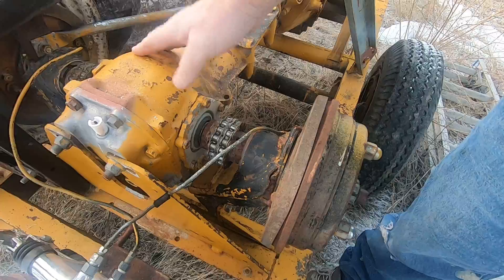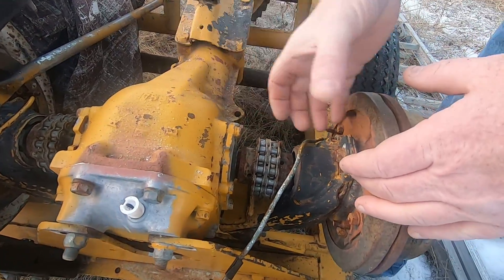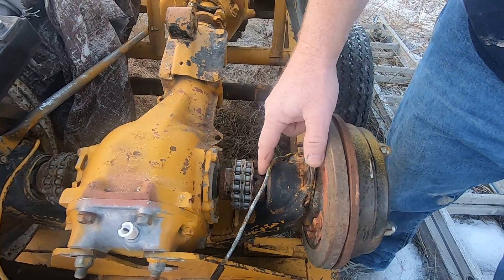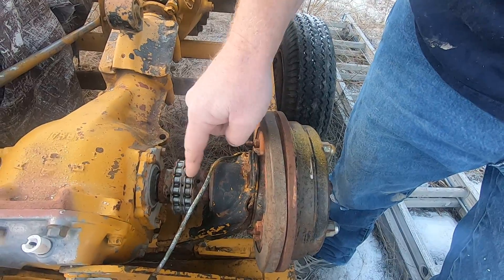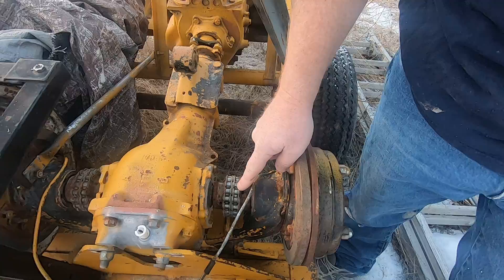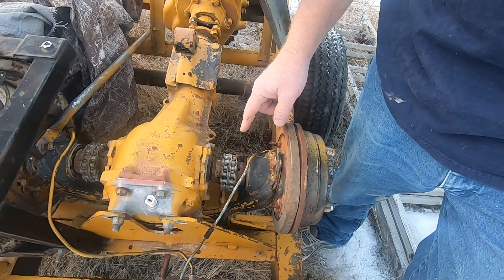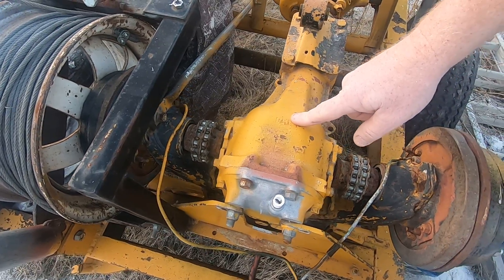These are just the rear wheels off of a Subaru, and this is a differential off of a Subaru. On a Subaru you have that axle with two CVs — we put the CV joints on the lathe, cut off the bells, shortened them, and welded on these sprockets. This was a chain coupling — you can find them in surplus catalogs and the like.